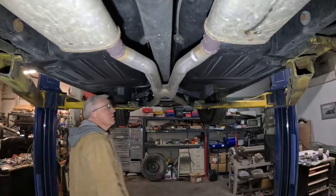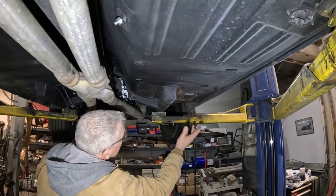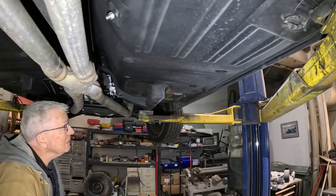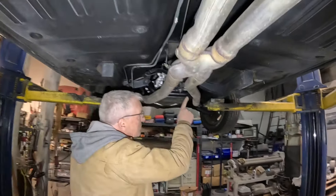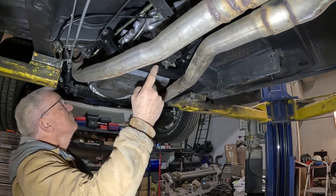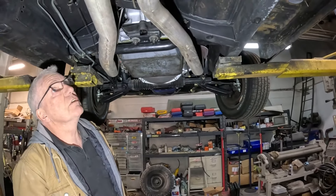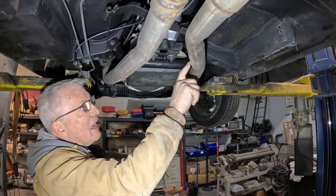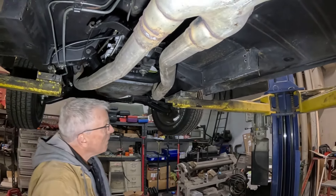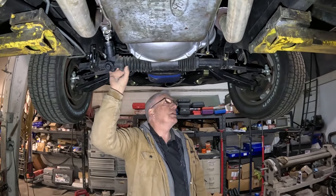It was done a fairly nice job for the most part. There's a floor section put in here, which is not unusual — not the worst job I've seen, not the best. One thing that jumps out is just up here: this is a different cross member. I'm guessing it's an aftermarket cross member — it's probably an AOD trans — and that cross member is hard into the exhaust pipe, so that's probably the source of some of our vibration.